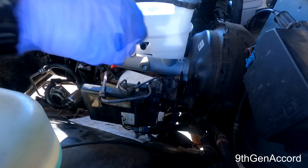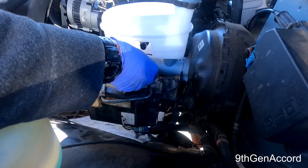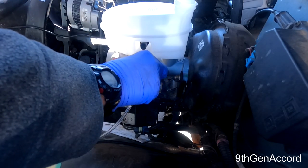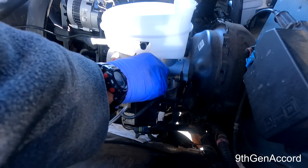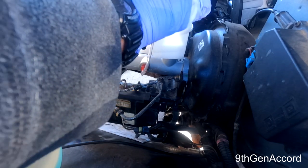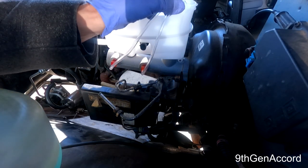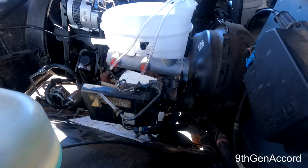Taking the little adapters that come in the kit and screwing those in like this — whether you do this on the truck or in a vise, I just don't want to have to take this off again. There are two clear hoses that attach to each of the nipples and then loop back down inside the master cylinder reservoir. That's the bench-bleeding setup.